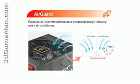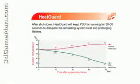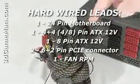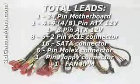This is a very simple but effective way of reducing fan noise. Note that when the system is turned off, HeatGuard will keep the power supply running for 30 to 60 seconds to dissipate the remaining system heat, prolonging lifetime. They include a temperature-controlled quiet 135mm fan, so as the load increases and the inside of the power supply gets hotter, the faster the fan spins. This fan and the honeycomb ventilation ensures maximum cooling, so the power supply should remain cool in almost any environment. This power supply has lots of leads, but the main motherboard leads as well as the PCI Express leads are hardwired and can't be removed. The remaining are sleeved modular leads, which is excellent because you only need to use the ones required for your particular setup — this reduces cable mess inside the case and also increases airflow.